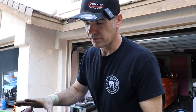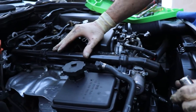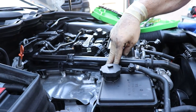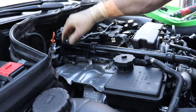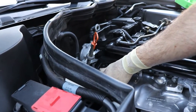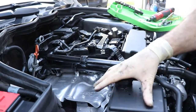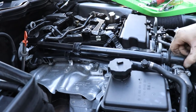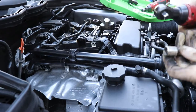So the first step — we've got our air pipe out of the way. We're going to go ahead and also replace this combination air and coolant pipe, because I can see somebody has already put some sealant on it, so I'm concerned that's going to be a future problem. Since we kind of have to move things out of the way to access the O-ring pipes anyway, we'll replace this while we're here. We're going to lose a little coolant anyway, so let's jump on it.